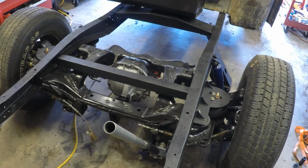If I went to a Mustang, what is it? If I go to an aftermarket hub, it's going to be a Cobra hub. That's what I'm trying to get to. And Cobra hubs are going to require a larger rotor, which can require larger brakes, which means aftermarket brakes. I'm not saying you couldn't find something, putting pieces together that would work, but it's just a tail chase.